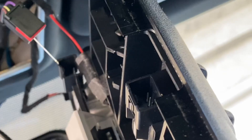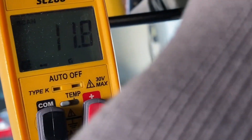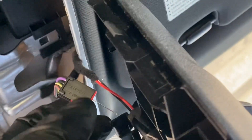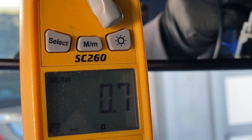Let's find out what the black wire gives us — let's clip the meter for continuity. The black one gives us 1.2 ohms, so I strongly believe it's the ground. That black and that other black are giving the same readings. Let's take a look at what we have on the purple one — and on the purple one we also have continuity but it's 0.7 ohms.